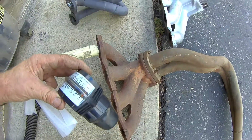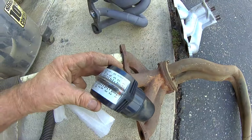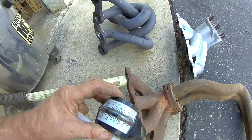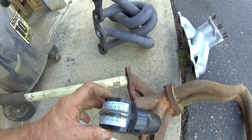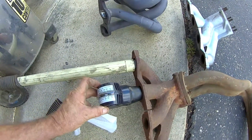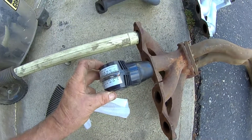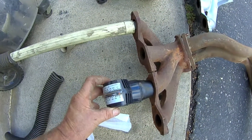Using our air flow meter - you may remember from the first video - this shows air flow in kilograms per hour. It's got a red needle that shows air flow through the port. If the needle runs up anywhere from 1 to 30, that shows how much air flow we've got. If the needle stays at the bottom or goes into the negative, that shows pressure. As you can see, the needle disappears - it's buried - so that means we have slight pressure. On this cylinder we have very slight suction.